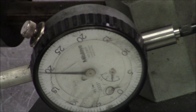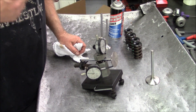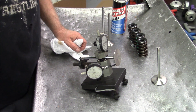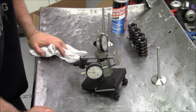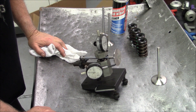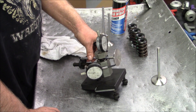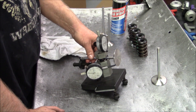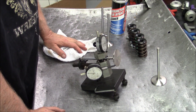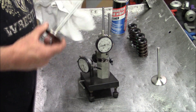Here's the problem: when you have all this runout, when the valve comes down and hits the seat, it's hitting on one side of the seat, then the next time it's hitting on the other side — it's fatiguing the tip of the valve. You don't have good heat transfer through the head of the valve to the seat, and it starts tearing the guide up because the valves are fatiguing back and forth. We'll take another look at it in about another year and see how it looks, but I would say these are probably better than a lot of aftermarket heads — but it might not be a bad idea to go through the valve job on them.